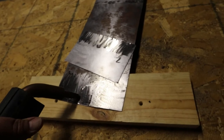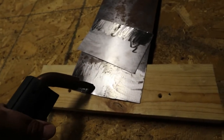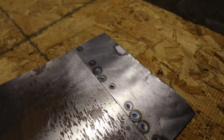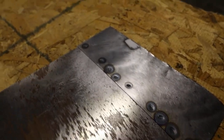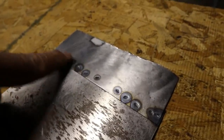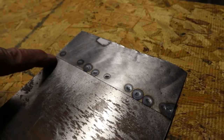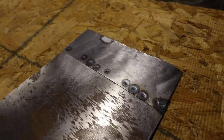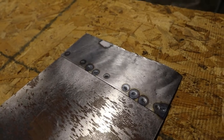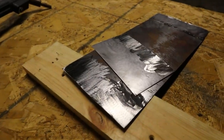For thinner sheet metal, I probably won't go more than 3 or 4 seconds. When you weld through the spot welds you get these little divots — the marks the welder leaves. You can see how it welds little circles, which you would later grind off and you've got almost a flat surface. Versus if you use a MIG, you'd be stitch welding the seam, building up a weld line that you would have to grind down smooth before you even do your body work. With this, when you grind it down it's just about smooth — you're not putting in the extra effort or time.